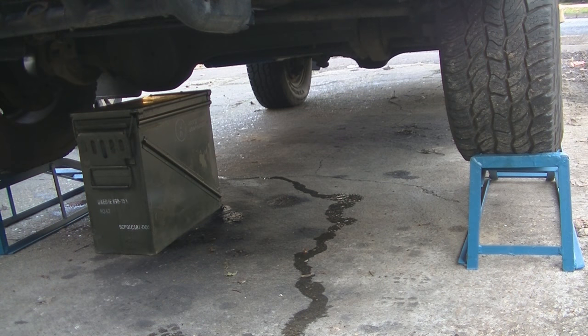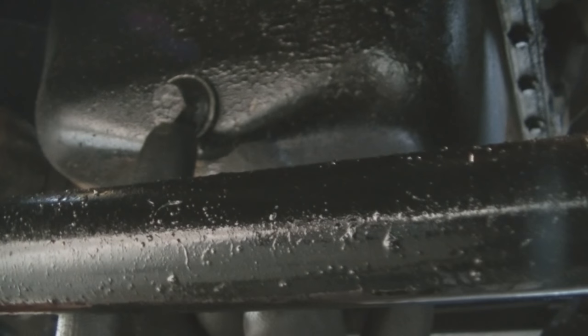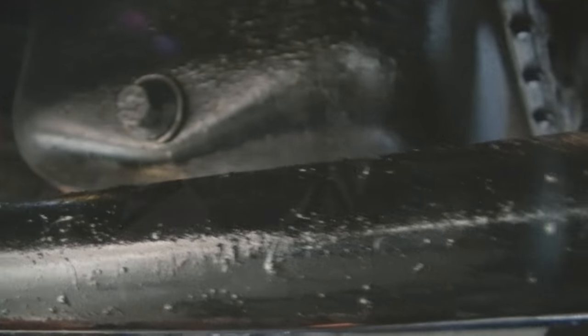So I've put it on the car ramp. All I've done is put that M19 ammo can underneath the diff so that if it does collapse, I've got time to get out. But don't ever work on a car without using axle stands or some sort of prop underneath — too many times it's ended up fatal. So here's the draining plug. Just going to undo it, put a container underneath, and drain out the engine oil. It's in the sump underneath the car, sometimes on the back, sometimes on the side.